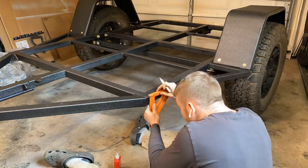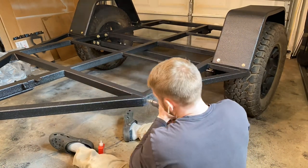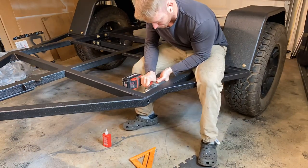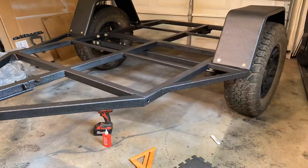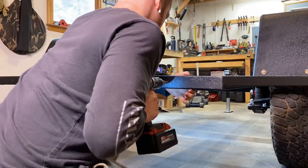Moving to the driver side is a rinse and repeat. I'm also taking a little bit of paint on a Q-tip — there's going to be some bare exposed metal after you drill your hole, so just go ahead and paint some primer on there, and when that dries I'll add some Steel-It as well.